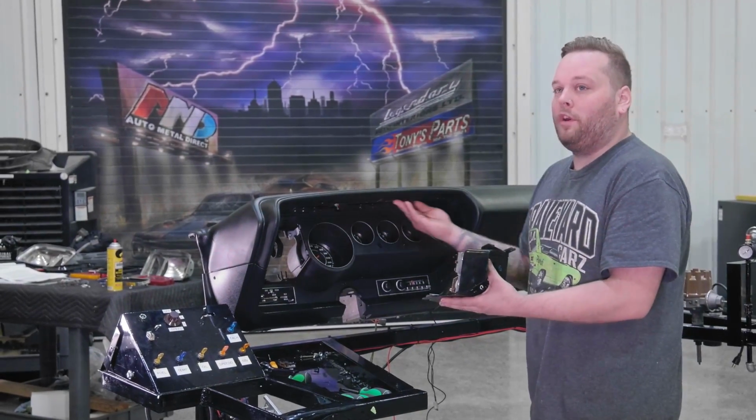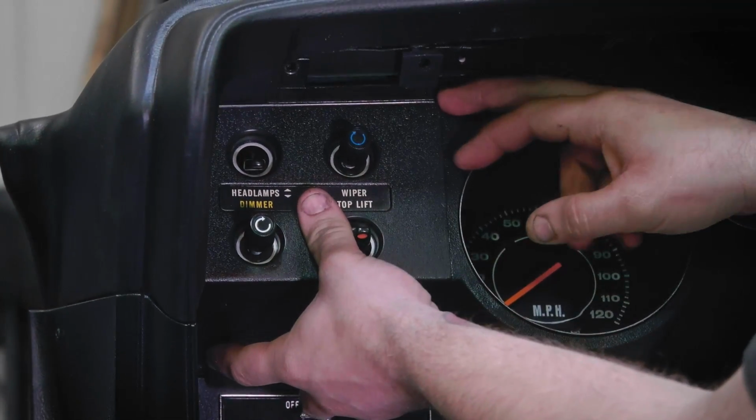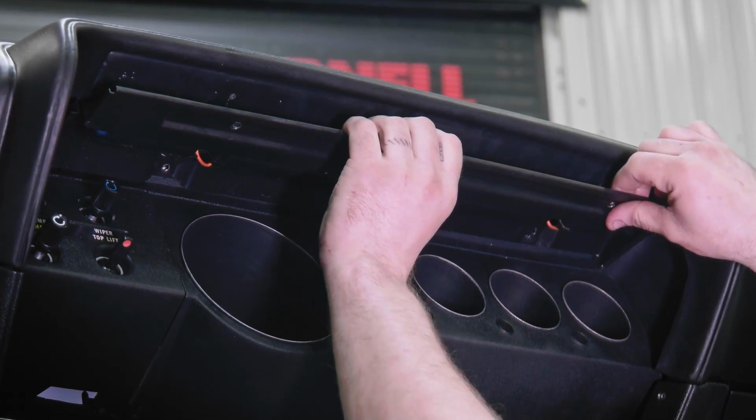I'm gonna follow that up with our dash lights. We did the dash ourselves, the instrumentation, the switch panel, we reconditioned everything. We put a new under-dash wiring harness in it, the heater box unit, put all correct stamping and everything back on that, an overhaul kit in it, new gaskets and foams, new heater core. I had Mike out of Instrument Specialties send me some of the, I think it's called Black Jewel suede dash paint in the original nitrocellulose lacquer with the suede on it. So that looked really perfect too. So it's a very nice looking OEM dash going in that car.